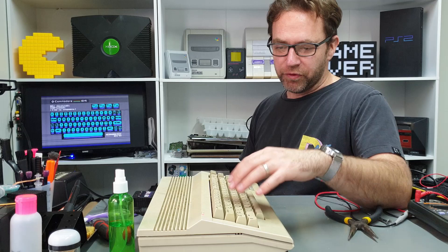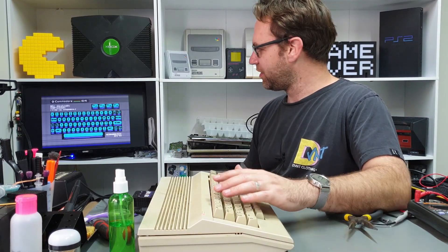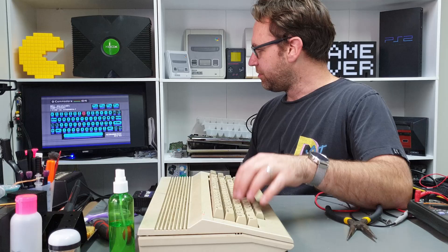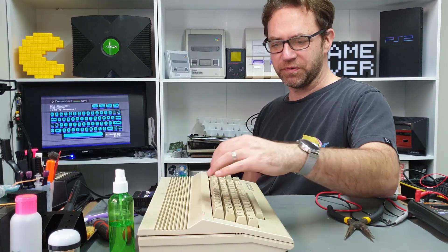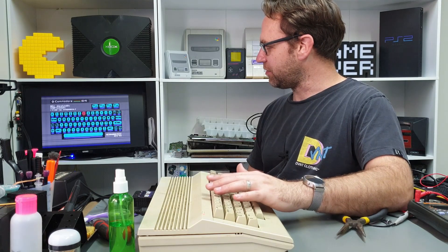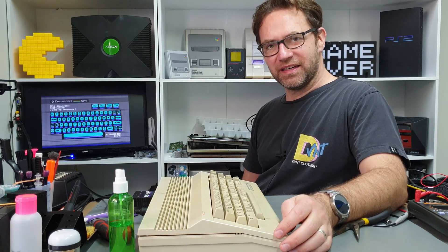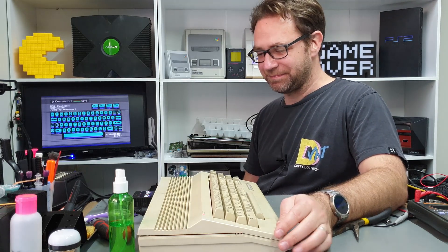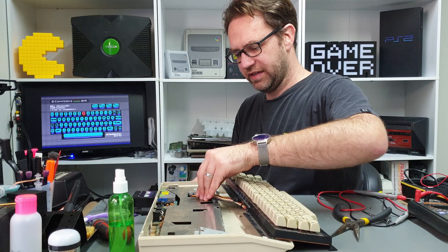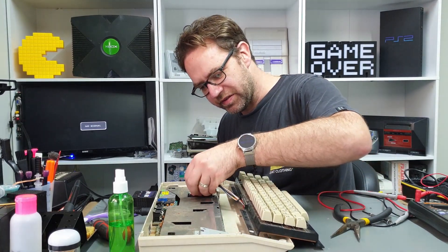Before I go pulling out the board I'd just double test it, make sure — and now all the keys are working, so go figure. This 7 key is actually missing a spring, but if I bump it around enough it'll actually make contact, which it wasn't doing before. I think I've cleaned up the contacts enough so that even the slightest touch will be enough to make contact. The keyboard connector in there looks pretty clean so I don't think it was an issue there.